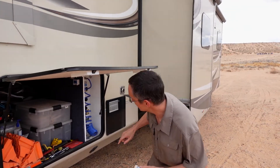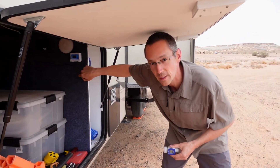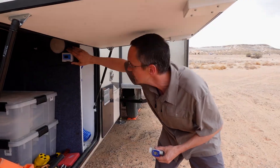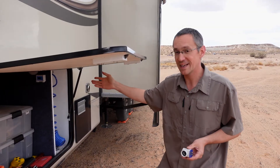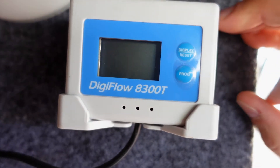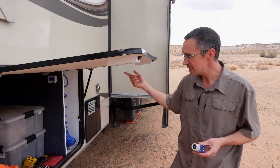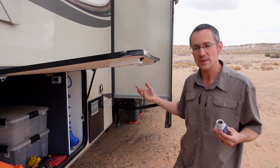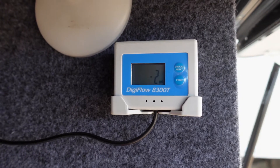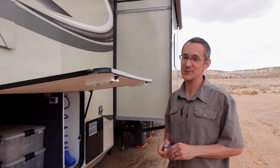The second water flow meter has a readout right here, and it's connected to the inlet of our water pump behind the wall, so it tells us exactly how much water we have used. You can set it up to 999 gallons, but we set it to 60 gallons because we have a 65-gallon freshwater tank. When it counts down to zero, every time water continues to run through it, it beeps to let you know you're getting low — that's your signal it's time to go fill water.